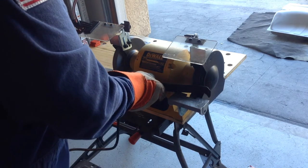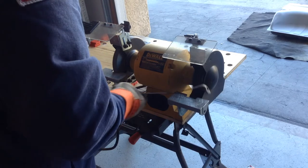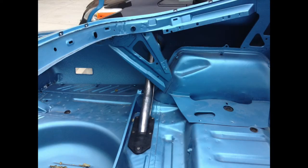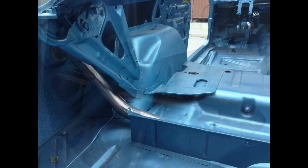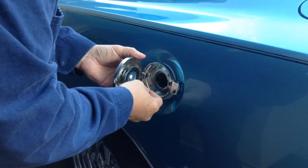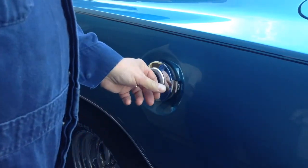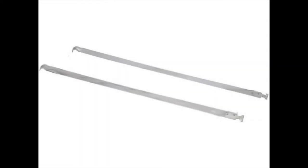You can restore the mounting strap by putting it on a grinding wheel. The key seems to be to get the fuel filler tube somewhat in place and then slide the tank onto the tube from below. Secure the rubber fuel filler gasket with the five screws that attach it to the cargo frame. Securing the filler tube and the cap to the quarter panel should go easy — the same screws that hold the cap to the body also hold the tube to the quarter panel. Installing the gas tank isn't too difficult, but it is tedious.